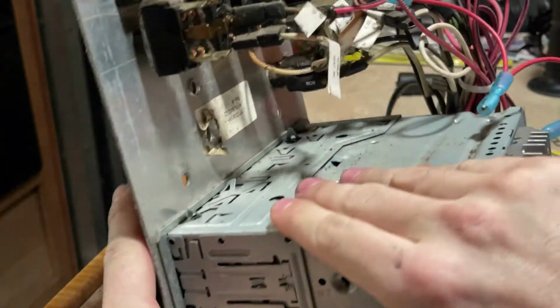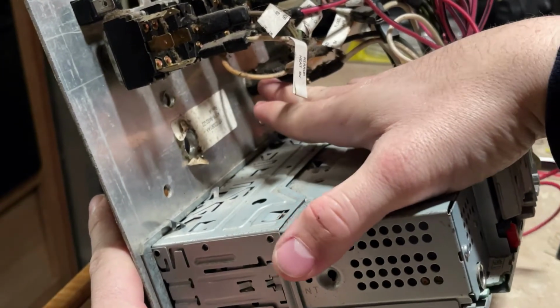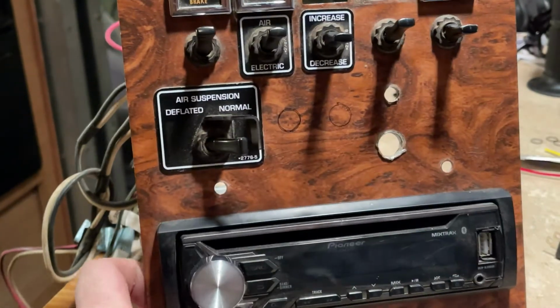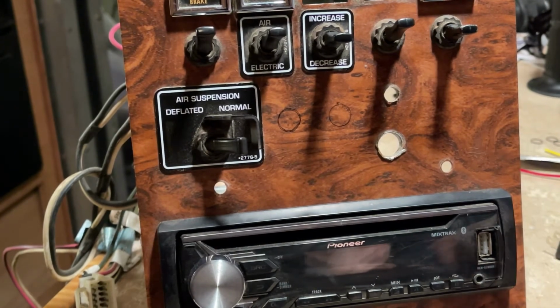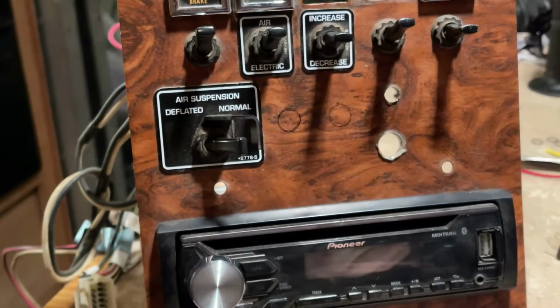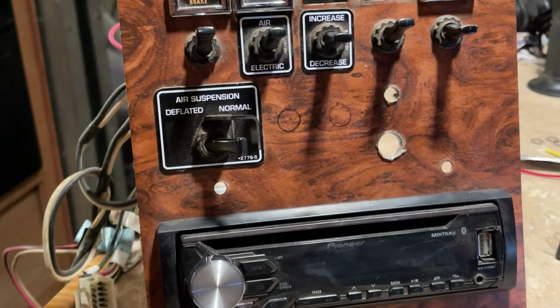Now just to confirm, it's going to tuck in right below the switches on the back side, right about here, right alongside our dump valve for our air suspension. And then I believe I found that a 15/32 drill bit is the closest size for the diameter of the thread on our switch. Go ahead and mount that up in the drill. Drill some holes.